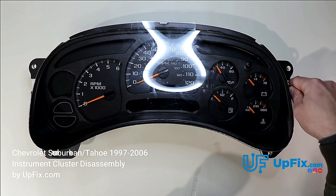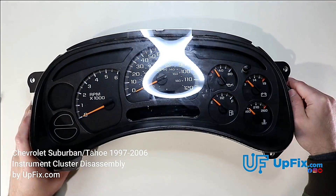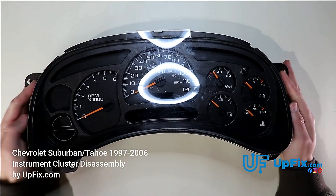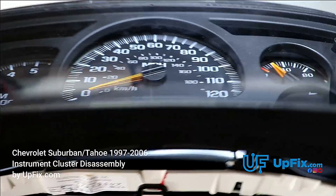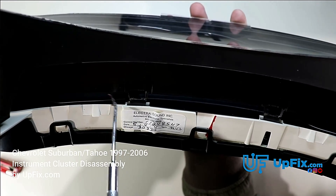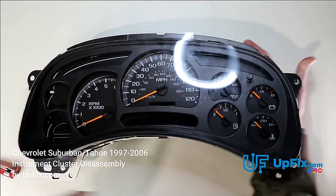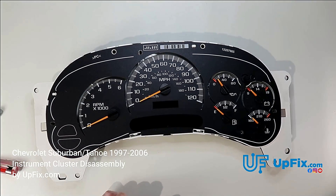I've got one tab freed up — let me show you what that tab looks like. The tab is already loose and we're going to do the second one here. I just drive it inside and do the other side like so. You'll notice as soon as I'm pulling up what that looks like — you can see the two tabs when you're opening it up. You're essentially trying to pry into one corner of the tab and lift it toward yourself. That's the tricky part about opening up this plastic lens cover. Now that it's removed, we're going to further disassemble it.